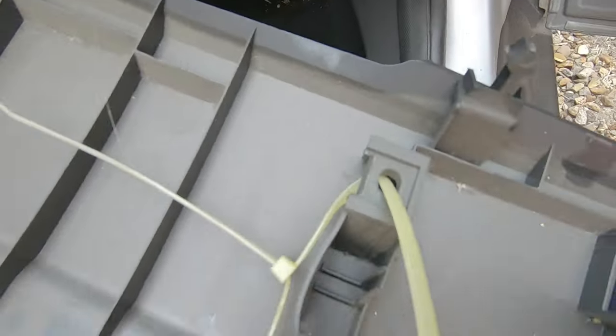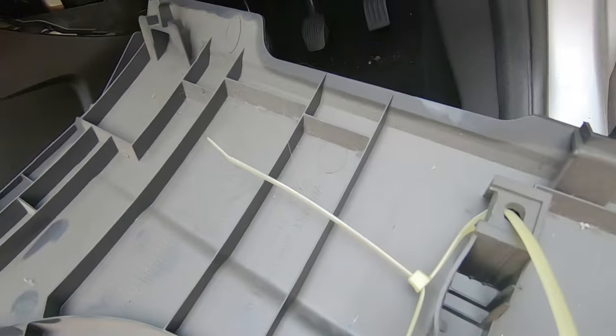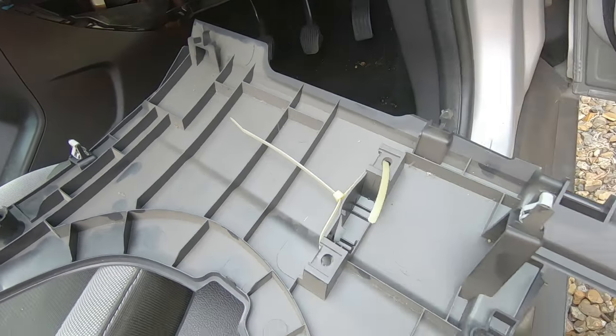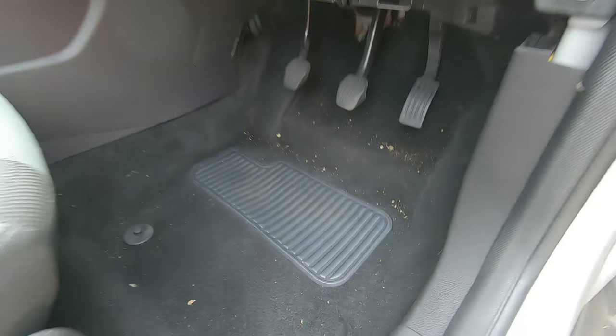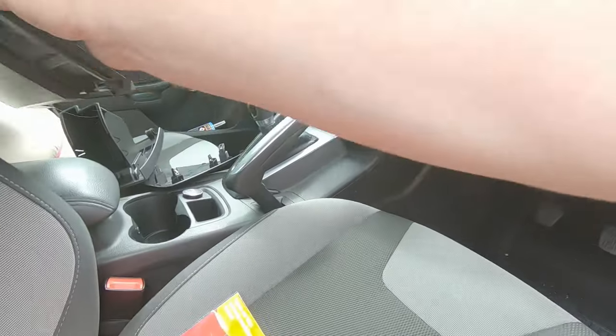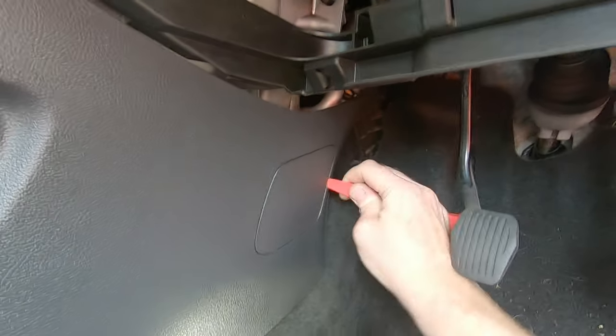There's your weirdness - it is actually clipped in. The cool thing is this is obviously meant for this specific purpose - it has actually got a little arrow tab here. For the electrical connector you do actually have to push the release button on the side and then slide it up, and the electrical connector comes up. I've tucked it up out of the way so it doesn't get any coolant on it when we're cleaning up. Another piece of trim goes away and now we can see a bit better and have more room.